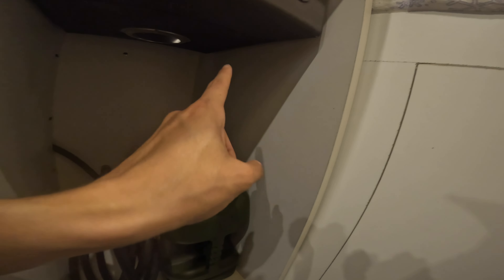So we're just going to spray this leak detection stuff on and we'll be looking for bubbles - that'll tell us if we've got leaks. I don't see anything on this one, just nothing really happening there. Or this one either - you guys probably can't see as well but I don't see any bubbles. I forgot to turn my mic on here, but I ended up just testing all of the burners again, checking for leaks, and then I also tested the stove as well to make sure it was working.